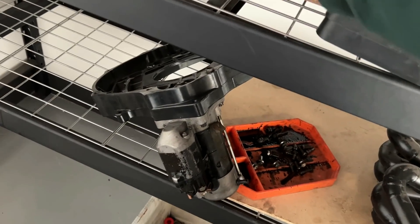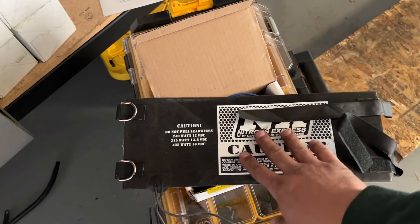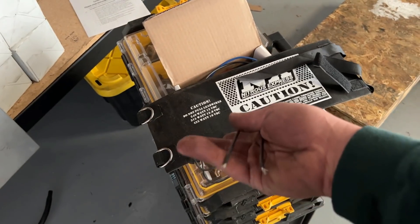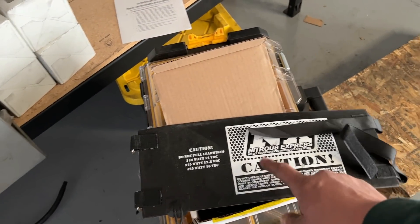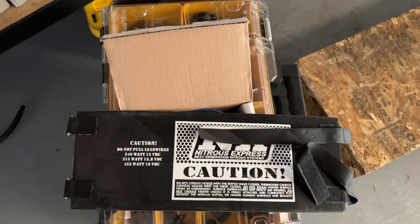The other thing you may or may not need is a bottle heater. These go on the bottle, get hot, hook up via a relay system, and essentially excite the nitrous — heating raises the pressure. That's why you see guys using a torch on nitrous, and also why guys will fill bottles by putting them in the freezer to bring the pressure down for differential transfer. Bottle heaters are pretty nice — I'm just too lazy to put them in, but I do have two and should probably wire those in for next year.